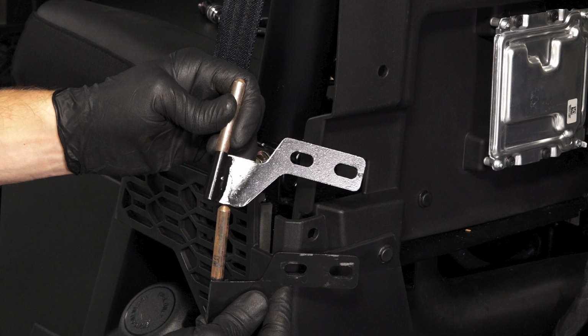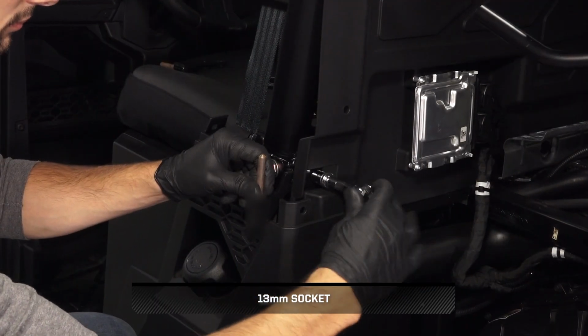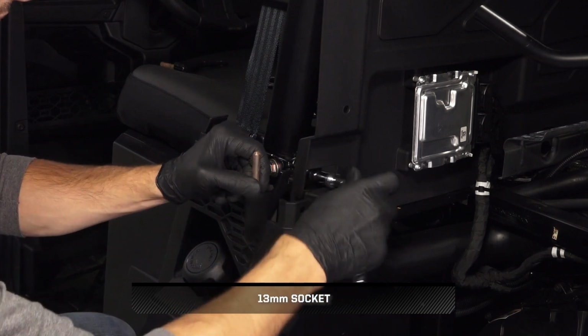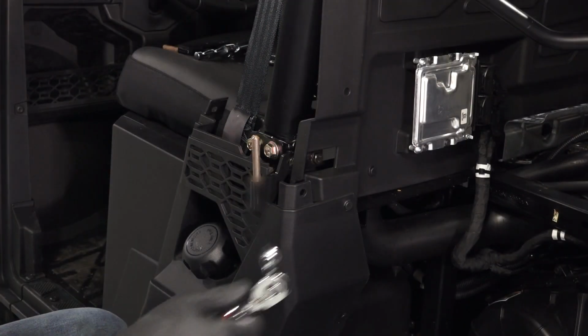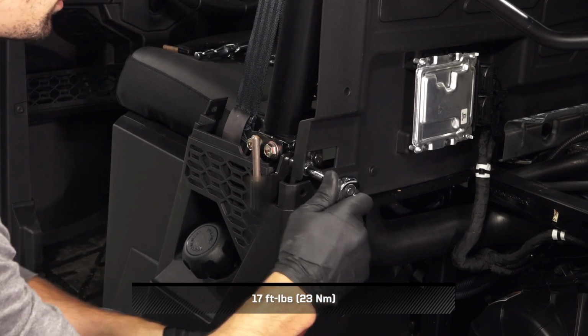Next, compare the two lower hinges. The hinge should face the front of the vehicle when installed. Then, align the lower chassis hinge with the mounting holes on the rear of the cab, and install 2 fasteners. Align the bracket in the middle of the adjustment range, and torque the fasteners to specification while ensuring the bracket remains level.